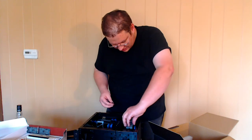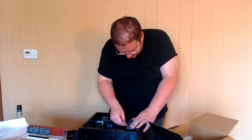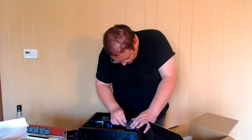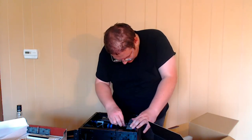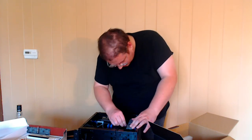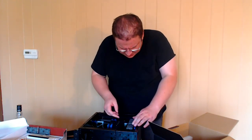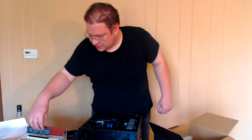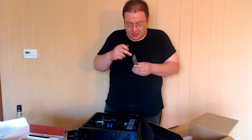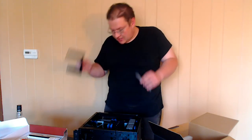Maybe. We'll see. Okay, so I will get this guy here locked into place. Let's take it down here. Yeah, ideally, you like to go about 2 fins, I'd say, when you go to slide these retainer pins in. And about how much would that be? 2 fins. So 2 fins is what you want to have for these clips. Okay. These little clips hold these on. These don't look like much, but they got a magnet on this side and this side. The purpose that they say they have is to hold these on nicely and snug.